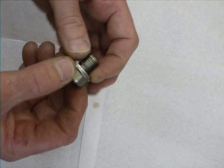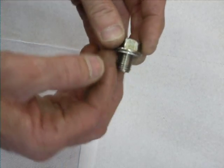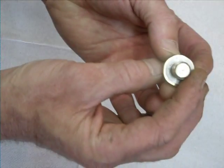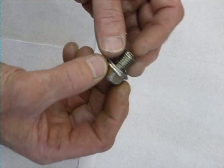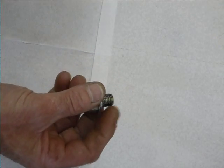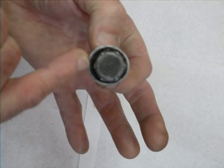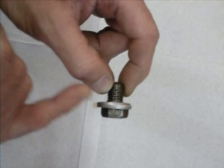It wasn't a surprise — I was waiting for this day for quite a long time. As soon as I put the spanner to the bolt, the thread came away with a nice spring of aluminium on the steel bolt. The drain plug on the Honda CM200 is on the side, not on the bottom, and the wall of the crankcase is quite close to the bolt head.